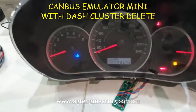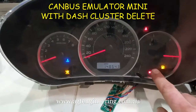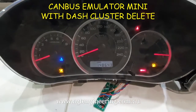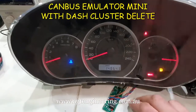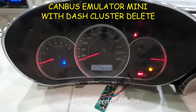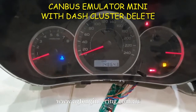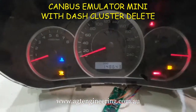Once it's done, there's an ABS light that normally comes up down here, and once it's done that'll stop flashing and the ABS light will turn on to say the process is complete. Once the process is complete, you can disconnect it — it's just connected directly to the cluster, nothing else. Then disconnect from the cluster and put it into the body computer of the Gen 4.